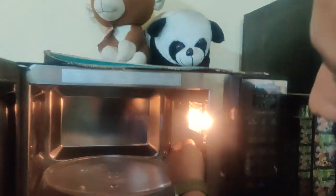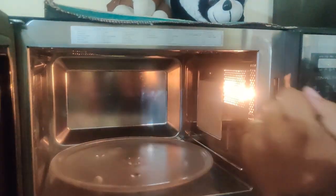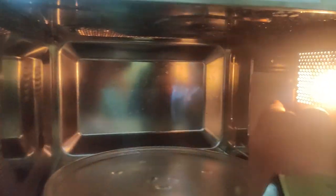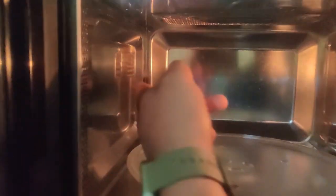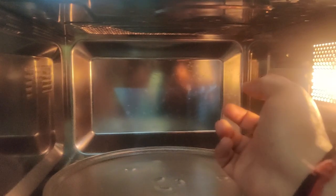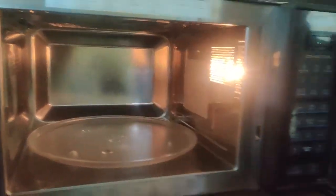If you look inside, on my right-hand side, behind that plate there is a magnetron, which we call the heart of a microwave oven. When this magnetron releases microwaves, they come from one end and hit the shining surface on the other end, causing continuous reflection. In this way the food is cooked not only on the outer surface but also inside.